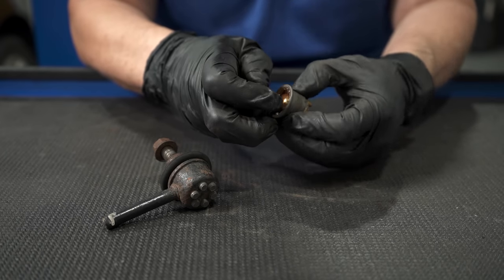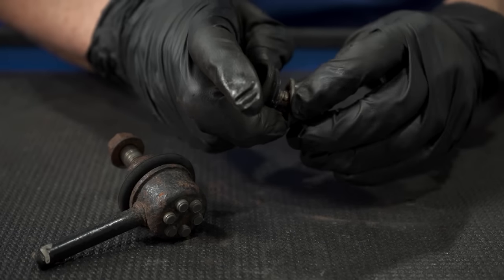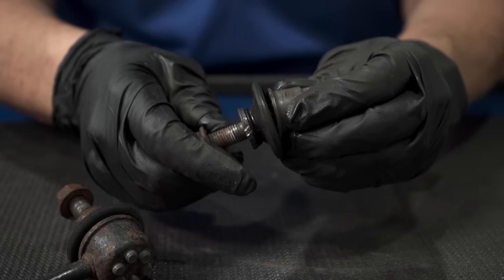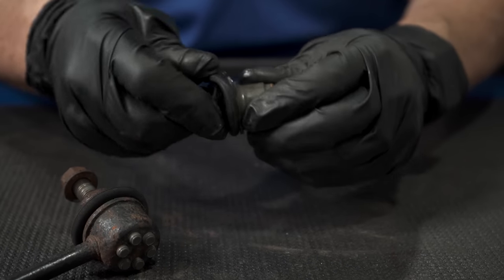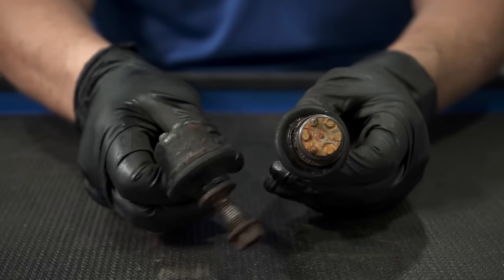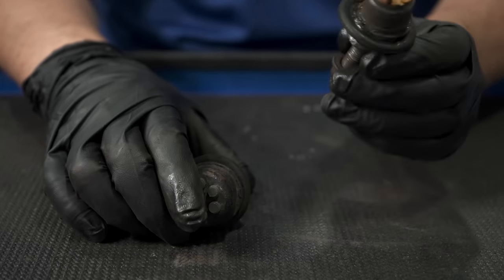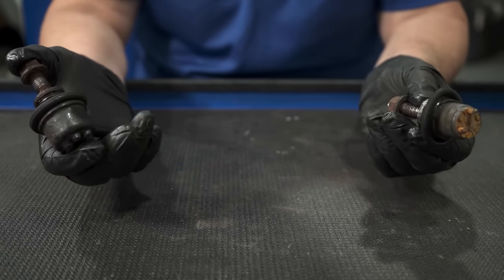So this is what it looks like in there — it's just a little ball joint. A little milled-out ball on top of a stud. It goes into a cap that's locked in with grease, sealed. That allows it to pivot on turning corners and up and down on bumps. What happens over time is it just wears out — there's a flat spot in there and it just knocks and knocks. That's how it's supposed to be attached, but unfortunately this one broke off — a pretty dangerous situation in the hardest place, up by the tire and the firewall. Pretty dangerous, but a simple repair, and very, very inexpensive.